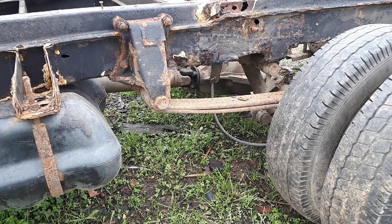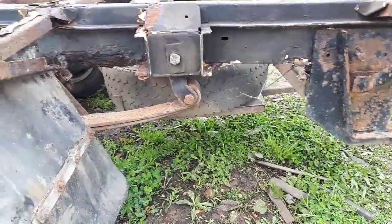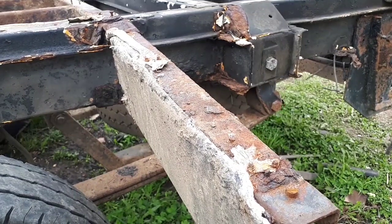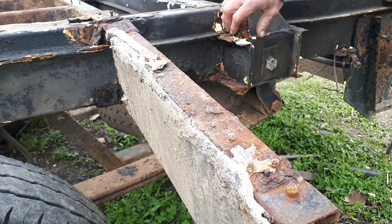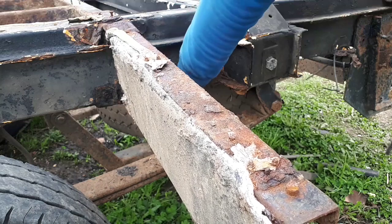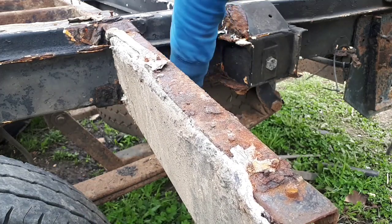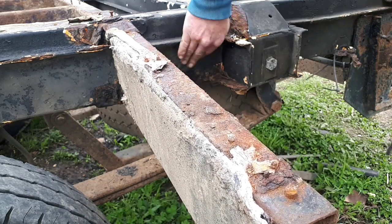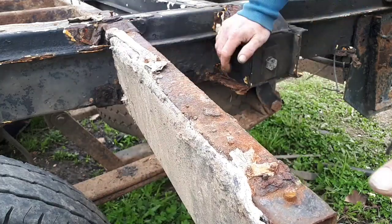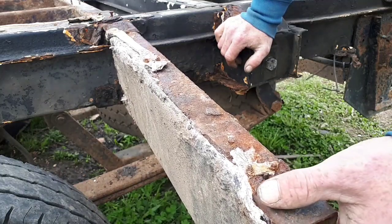The rear spring hanger on this side, which if I take you to here, is maybe better there. Yeah, that's it. It's a little more corroded than the other side. I don't know what to do about that. Again, I think this has had some welding on the bottom of this, but it's not holed. Whenever it was welded, it's still solid, but it looks like it could be rather scabby under here. Again, from this outrigger. That was the knocking that I'd been hearing all the while that I've had the van.